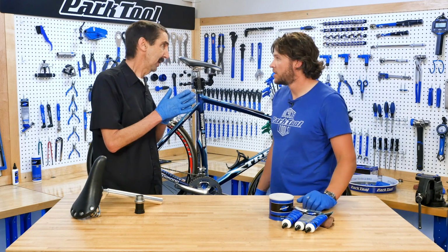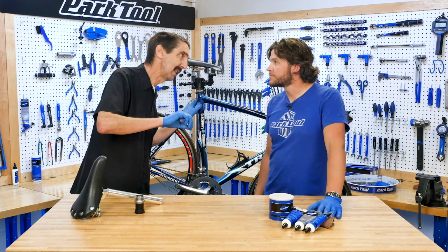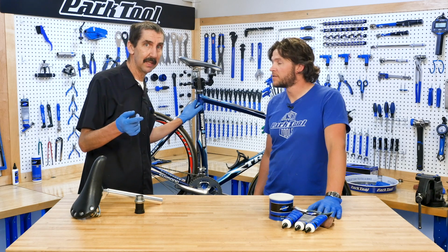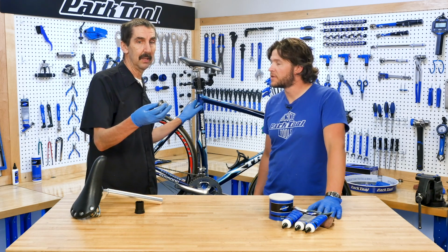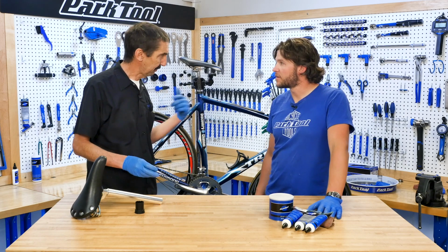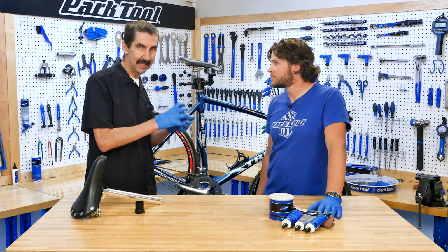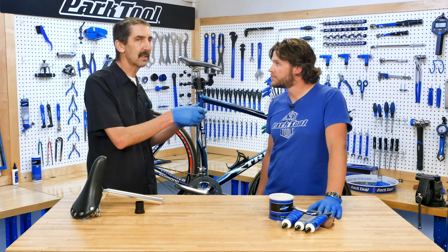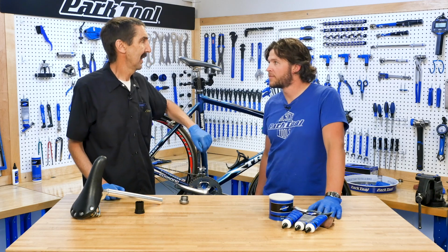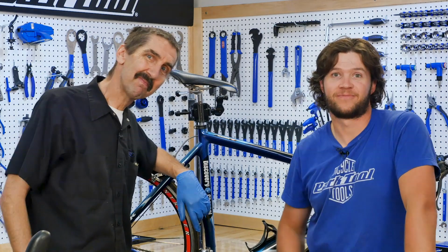Typically, we want to keep them separated. It's always good to check with the manufacturer, but typically, it's better to have something there than nothing. Well, it helps performance and serviceability and taking stuff apart. So dry threads with some lubrication, at least grease, is what we prefer for that static joint. That's right. Goes in, it locks up tight because of the good torque we put on it, and it's replaceable. We know that down the road it's going to come out just fine. Mm-hmm. Yeah. So, in conclusion, get greasy.